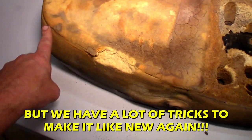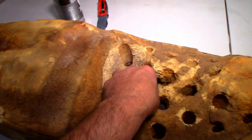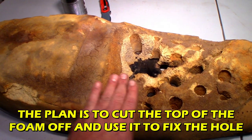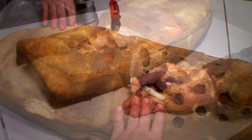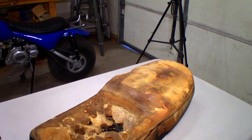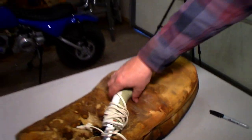I think we take the bread knife and cut the thickness of this camping mat straight across. Then we can use any good foam to fill in the hole - chop this off, glue it down in here, and trim it with the bread knife just a touch so it's nice. Then we'll use the DA sander to get the right shape. The good thing about this closed cell foam is it sands really nicely with the DA sander. Only problem is it's a little stiff, but it's about ten dollars for that mat.